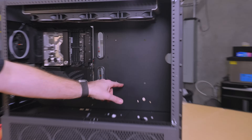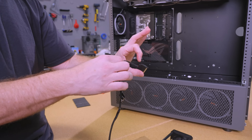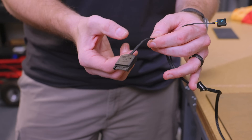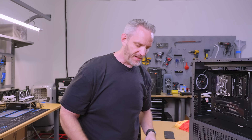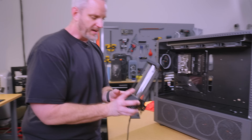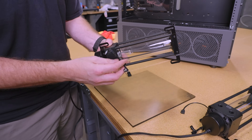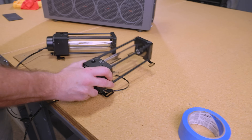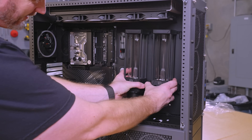I have a choice I have to make. I need to make a big hole with maybe a threaded grommet or a U-notch so I can push cables through and have the grommet go on, or I could cut this — it's just ground and 12-volt — cut it, terminate each end to like a male and female three-pin fan connector, push the wire through, and just plug those in because they're keyed. Let me just hold these up so you can sort of see. I like the fact that technically these are daisy-chainable — I could daisy-chain the RGB together — but I hate the fact that they use a JST plug. So you have to use this adapter, which means more wiring.